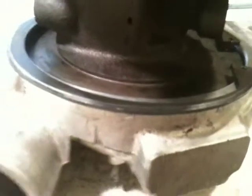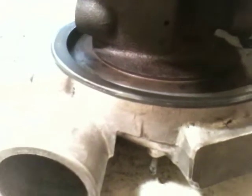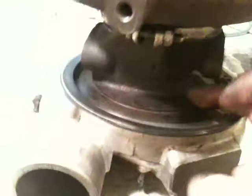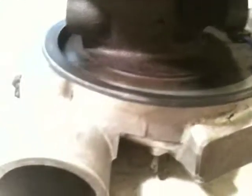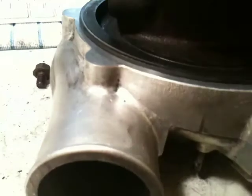As a side note, I probably should have said this before, but before you take the turbo apart, it would probably be a good idea to mark the relationship of the turbo compressor housing and exhaust housing in relationship to the center housing. I did not do that, so I'm just guessing. I know I can rotate and move these after installation, but it's just one of those things — I took it apart before I thought about that.